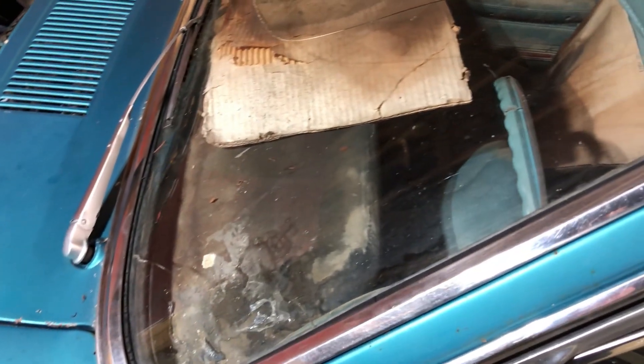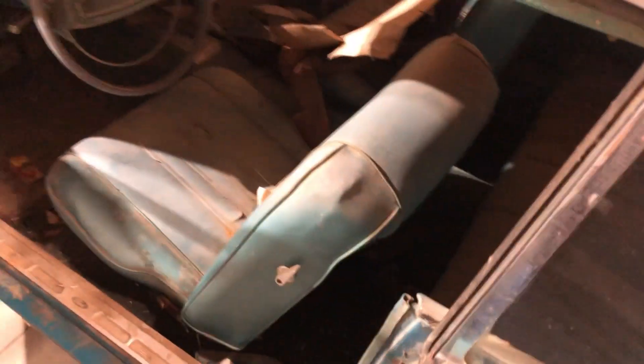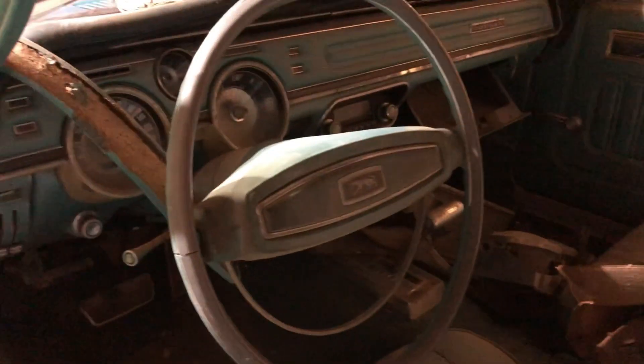Taking a look inside — the dash was covered with cardboard when I first looked at the car, so someone made a good attempt to protect it from the sun. But the weatherstrip around the window gave out and water started getting in, which kind of ruined the dash pad. This door does shut and lines up pretty nicely, though the hinges need new bushings — you have to lift up on the door to get it in. I have not cleaned this car yet; this is exactly how I picked it up. My dad and my brother helped load it, so thank you very much to them.